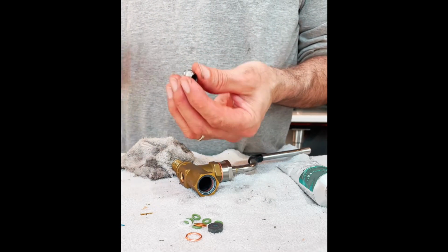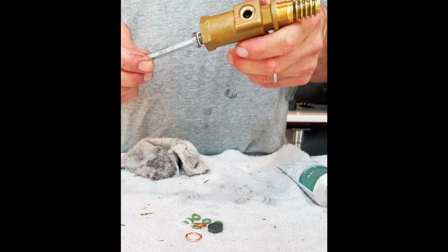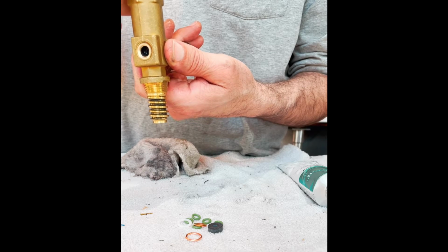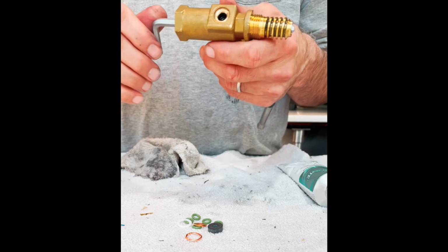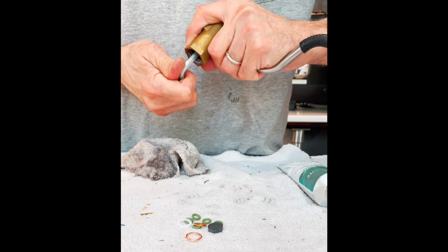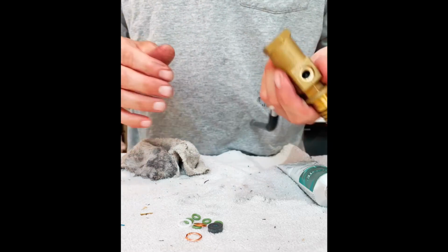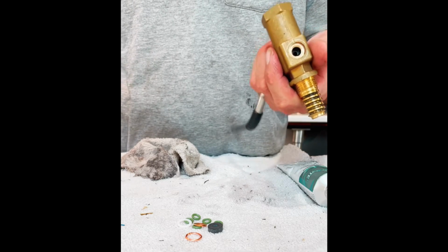And I go ahead and put the whole thing on my Allen wrench. Gently slide it in, let gravity kind of take it down, and maybe find that starting thread. Give it a spin until you feel it starts to grab, and then you can give it a tight hand twist, and that should do it. Be careful when you're working with that valve seat not to damage the surface with a sharp object, or even when you're pulling your Allen wrench out, try to come out evenly.